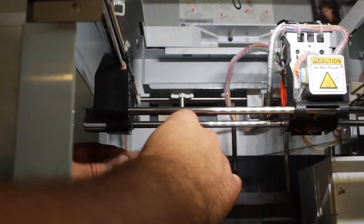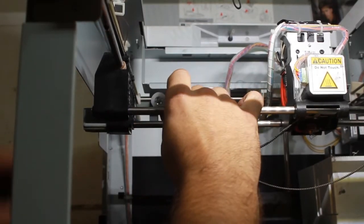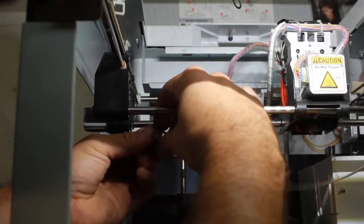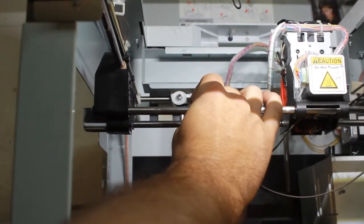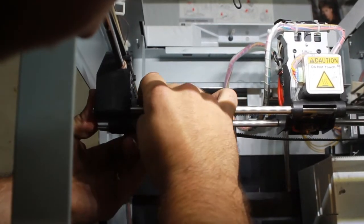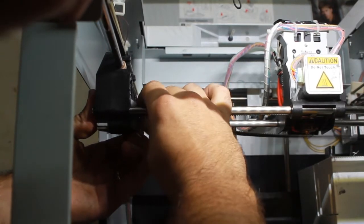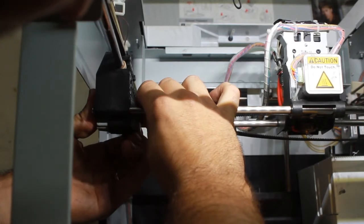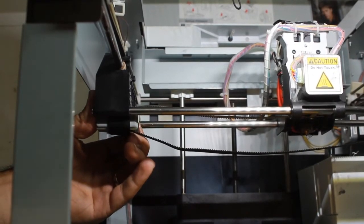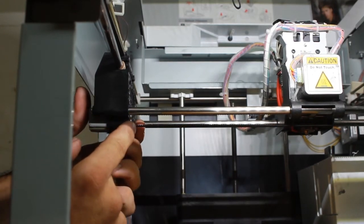What you're going to do is grab the pulley like that — let me show you a bit better — just like that, except a lot tighter so it doesn't come off. So now you push this part in as far as you can, and the pulley is just going to fall in gently, just like that. Because you're pushing that in, as soon as you let it go it's going to tension that belt with the spring — just like that.